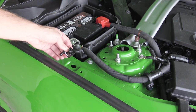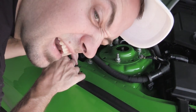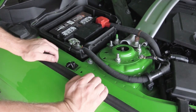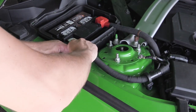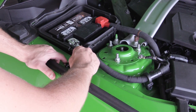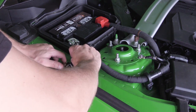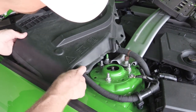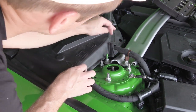The one with the circular indicators goes on the left side — that's what the instructions from CJ Pony Parts specify. Once you have it in position, kind of lift up on it as you're turning it and that'll hold it in place. Then you'll tighten it with an Allen key. Ford put a torque spec on this — if you have a torque wrench, it's 20 foot-pounds. I don't have one so I'm just going to tighten it until it feels pretty darn tight.